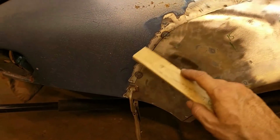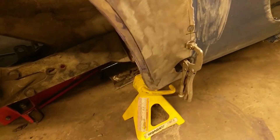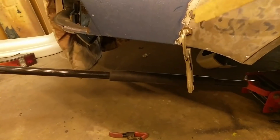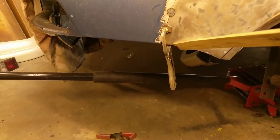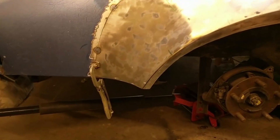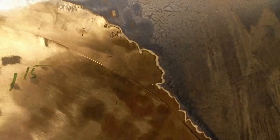I've started to tack it in at the lower sections. I spent a lot of time getting this torsion hole cover to line up to the existing fender, so I went ahead and put a tack in there and a tack in there. I also put some tacks back here to make sure everything lines up with the existing quarter panel and has the right shape based on my templates — so that's locked in place. I can always cut it if I need to, but now I'm just going along fine-tuning the gaps. Here the gap is basically zero, but here it's overlapping because I made that conservative cut.